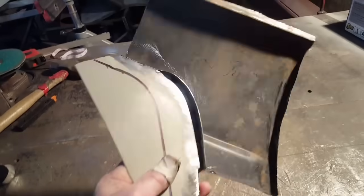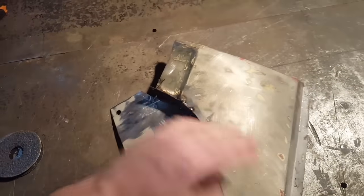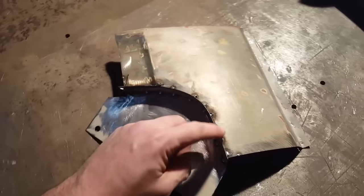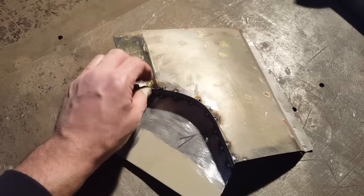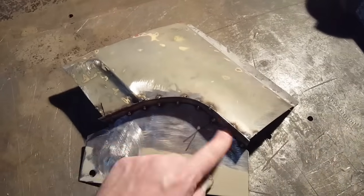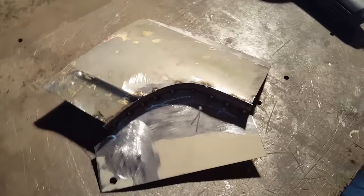That's basically all I've got done — two or three pieces of metal welded together. The three planes are there: this plane, this plane, this plane. Nothing pretty — I'll weld it all up and grind away what I don't need. There's one little trick: some people just end up welding on the outer edge, but I always like having this edge out here looking really nice and clean so it looks original. What I end up doing is welding the entire back side inside as well, so I've got a bit of build there. When I go to dress up this outer edge it looks original and you haven't got to worry about it. I'm going to weld all this up, clean it all up, and I'll be back.